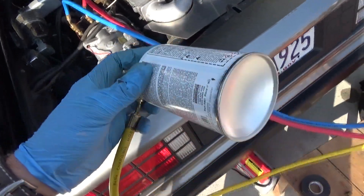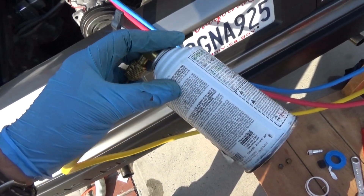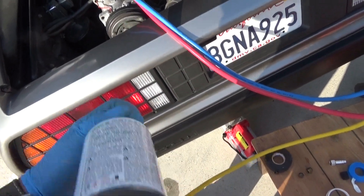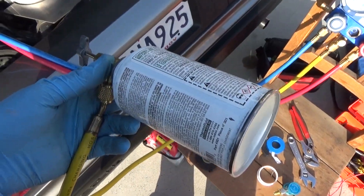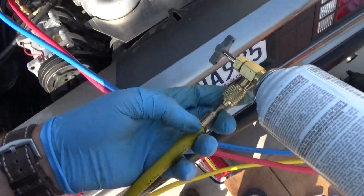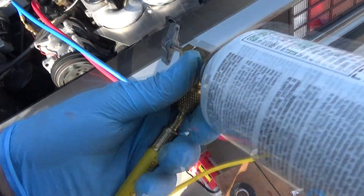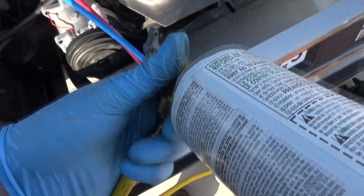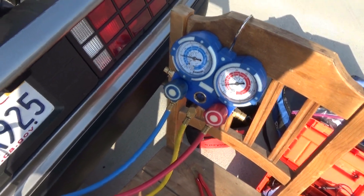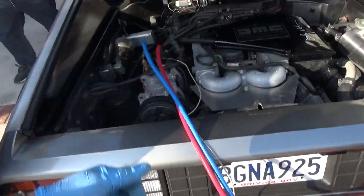After about two cans of Red Tech — you could go two and a quarter — we're going to try two cans first, and if we need to top it off later, we'll do that. It can be difficult to know when the can is empty, but as long as the fittings and hoses are cold and you can feel a flow, when that stops and everything warms up, you know you're out of refrigerant. Now we've got both cans in — disconnect your hoses, replace the caps, and you're good to go.